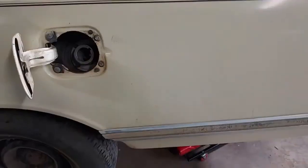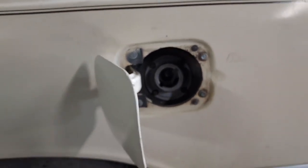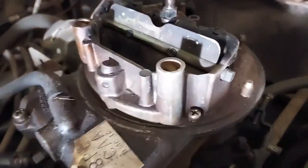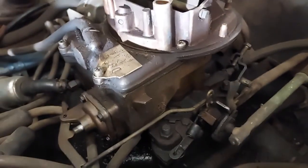Alright, I'm back up here at the shop working on the LTD. Yesterday Mike - I ain't gonna take no credit for it - he got the tank in and lines cleared out. We actually took the pickup tube over to the body shop and sandblasted it so it's clean. Now we're fixing to crank this. Some redneck ingenuity here - that little hole, we got that thing full of gas. If you fill that up with gas it fills the bowl of the carburetor up, and then that gives it time to pick up gas from the tank.